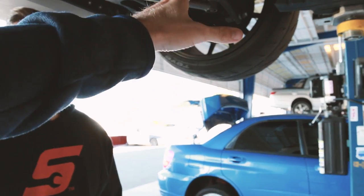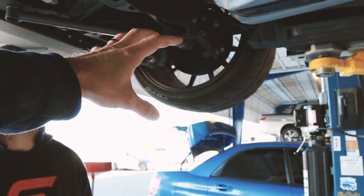The main reason too is because the front and rear wheels are driven at different speeds on this car. On a belt-driven dyno system, the rollers are connected through a belt so they don't slip. Since the rear is overdriven, the car thinks it's in a slide — that wheel is trying to spin faster than the front — so it gets this feedback and the stability control steps in and starts cutting torque, trying to shuffle power. If you watch on the dyno you'll see the power doing weird stuff because the car is trying to figure out how to keep you in line.